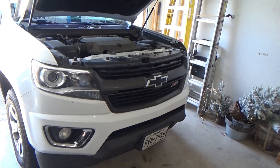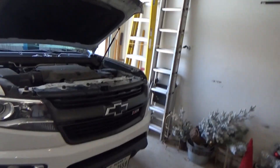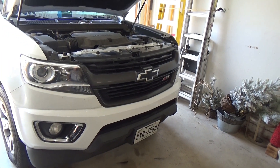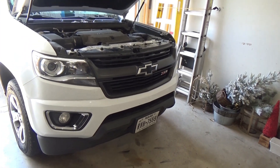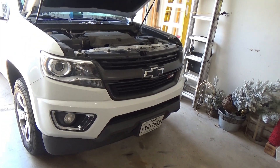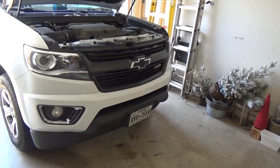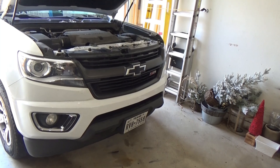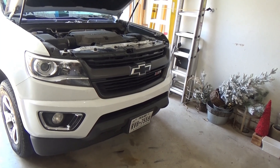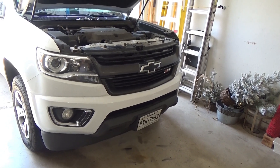A little engineering and we got it going. I couldn't really find any decent videos — one guy had the camera shaking all over the place and you can't tell what he's done, and another guy just pulls the bumper off and drops it on the ground. So I thought, since I've got to do this, I might as well film it and show y'all how to properly do this. One thing I will tell you: you've got to take the bumper off — that's the proper way. Don't try to take the grill off because you will break the tabs. If you replace the grill on one of these, you're supposed to take the bumper off and use a tab remover tool. Just do it the right way.